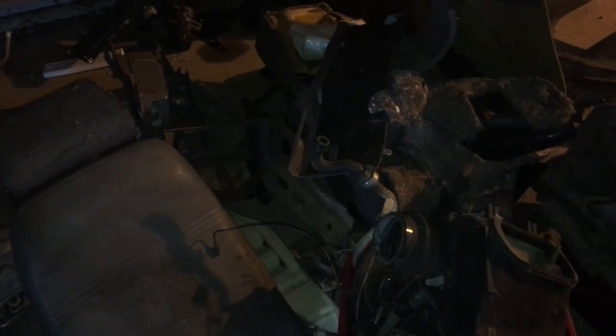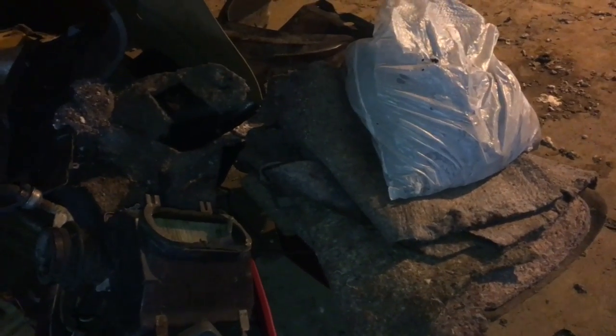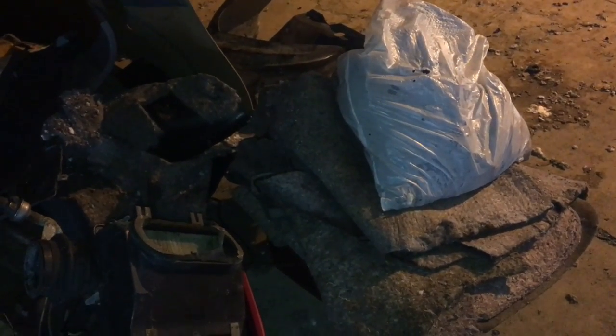Alright, here we are with some of our initial weight loss stuff. I'll run through this real quick because it's always just super boring — it's just a bunch of garbage. We're out here at the secret facility, otherwise known as the dump now because we've got most of this garbage-y Mustang out here. Front sway bar was 22.7 pounds. Dog bone was like 9 pounds. Front bumper was like 22.4 with the bracketry. The fog light bar was like 15 or so. Console and radio was like 9.5. Quad shocks was 6. The seat with no bracket was 41. This miscellaneous tow stuff — got smog pump in it and some other things — was 56, 57 pounds. Rear sway bar's 11 pounds. The fan and AC stuff was like 6 pounds and like 14 pounds. The rear seat was 39.5. Just the sound deadener, all the sound deadener stuff, was close to 70 pounds what I've got out of it so far.